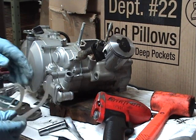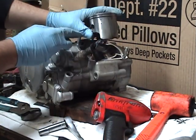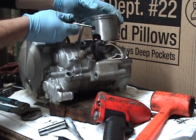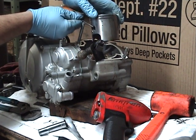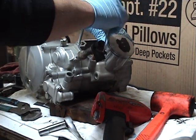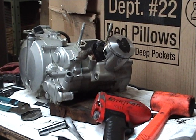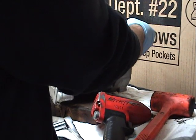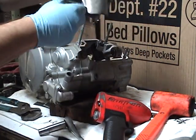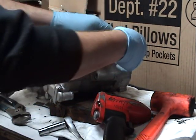One thing I would recommend here is a pair of safety glasses when you're doing this to any piston. I've had some of these clips, rather, not cleats, bounce out off my cheeks. Come pretty close to my eyes. That one went sailing. You probably don't want to let them go sailing because that wouldn't be cool to step on later. But don't ever reuse a circlip. Those things are 50 cents or whatever and they're one shot. I got a nice Craftsman 9mm deep socket that works perfect as the piston pin pusher on most motors.